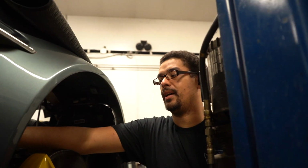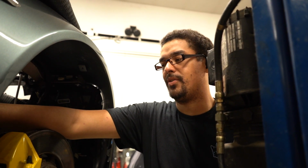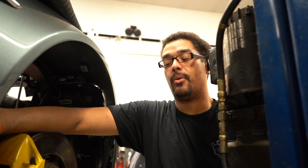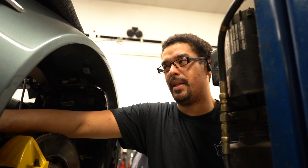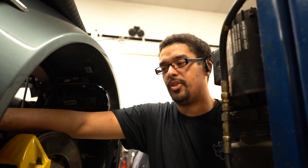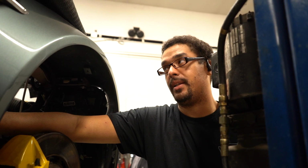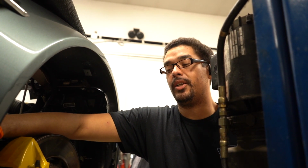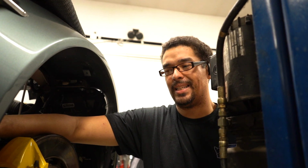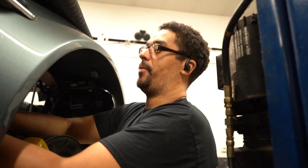I'm going to move the main power wire that feeds the back of the alternator and the starter to this other power stud here. And then I'm going to disconnect all the injectors so that the car won't actually do anything, and I'm going to test how well it cranks. If it cranks without the battery jump box up here, then we know we're getting really good current and voltage to the starter, which would suggest that that's the correct area to get all the battery juice from.